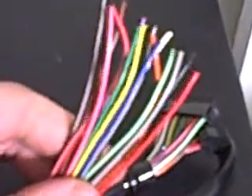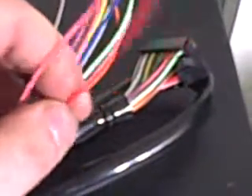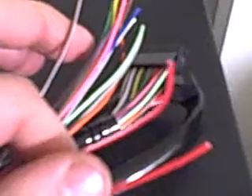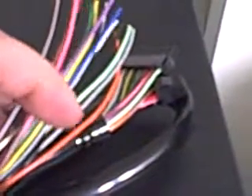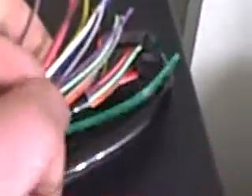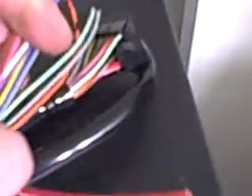Next we have the wiring. It's pretty simple. First you have the red and the red-white wires. These two wires are the ignition power — it's a 12-volt source. These go into your ignition on the ECU. Next up you have the dark green wire. The dark green wire is the RPM signal. This is what displays how fast the engine is moving in RPMs on the screen.